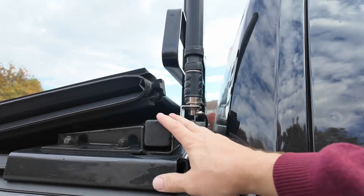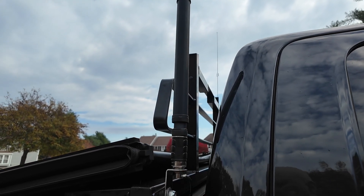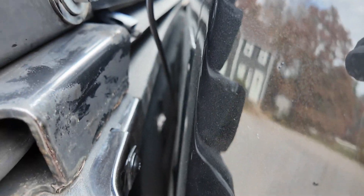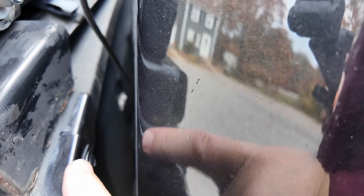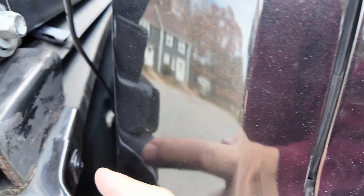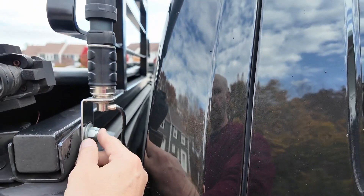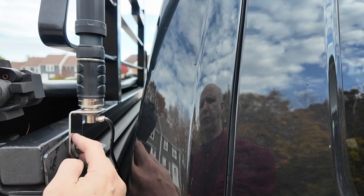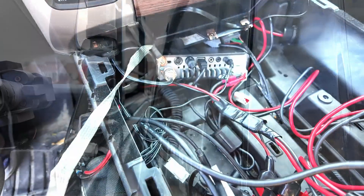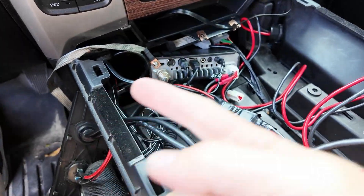At that point this overall bed will get tied into the frame. I have a scenario here where I've got a back rack where my ATAS is tied into. You've got to be able to bond the bed all to the frame down below. I can see a small cavity down here and a decent surface which I can probably mount a bond to and run that down to the frame, but this antenna I'm probably going to have to take the nut off and run a grounding strap just so things stay neat and tidy, attaching it to the radio. I have this long braided cable that I'm going to run underneath the dash and feed through here.